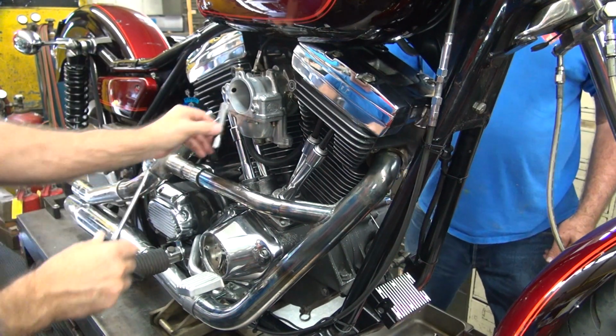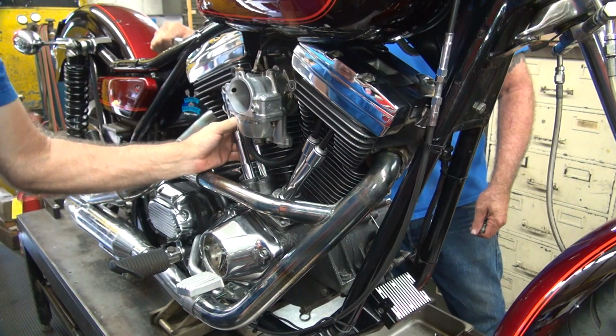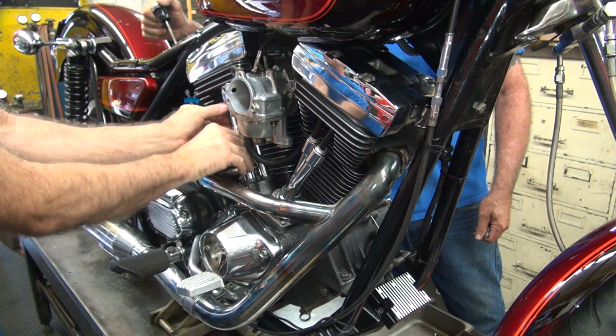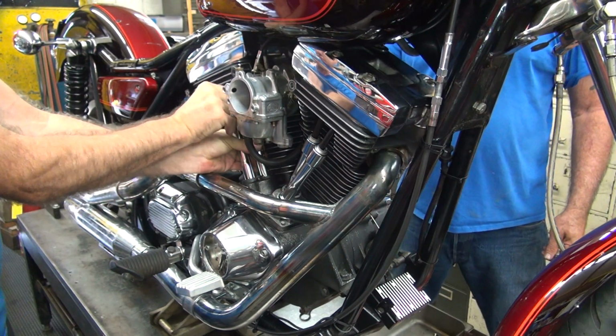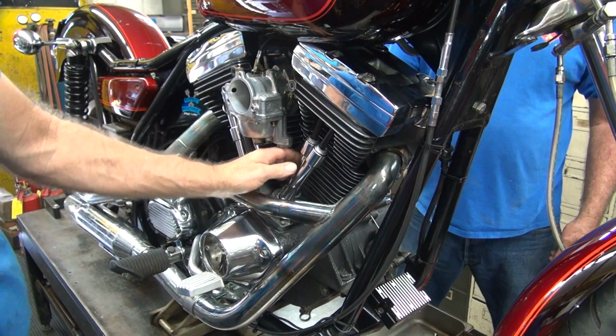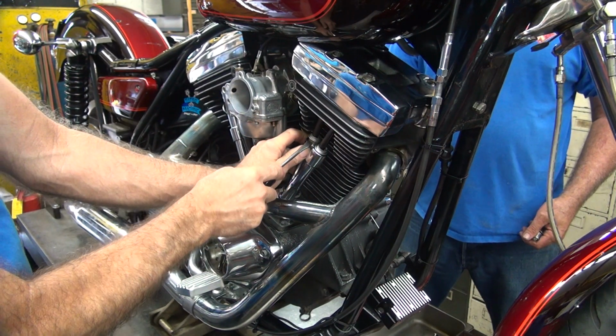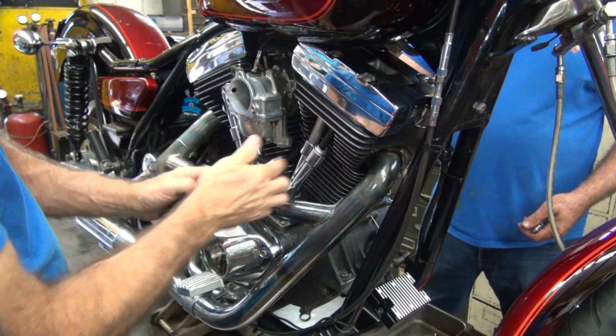Check the oil tank, see if there's any oil in it. I didn't need to today, no. That was a statement of things to do. Yeah, it's still right there at the line. Right where it was yesterday. A little bit lower yesterday, but I think it must have settled a little bit. So we didn't suck a whole bunch of oil into the crankcase. That means the oil pump check valve is working. That's a plus. So the motor all seems to be physically in good condition, which is always a good thing.